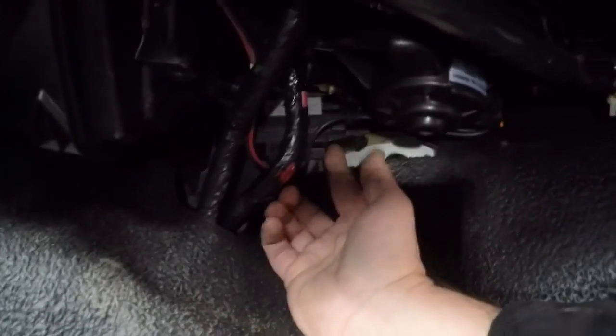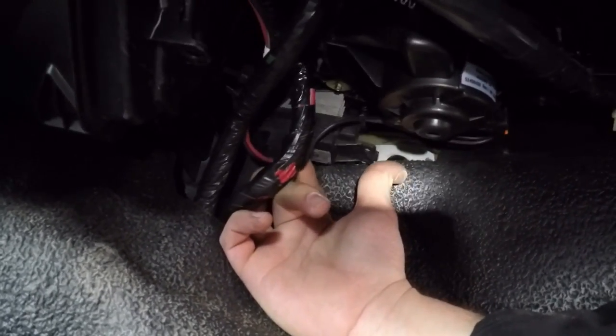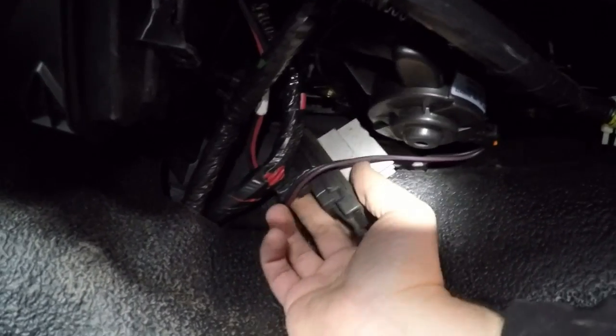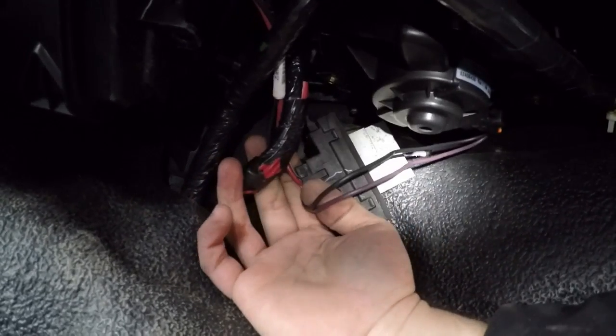The BCM is under here. You can see it's hanging down because I've already got it loose. If you pull the wire harness free, you can get it out of there. To get it out, you're going to have to remove the harness from both the module. I unplugged the motor from the black and purple wire that continues from the control module. The tabs on both harnesses need to be released so you can get the plug out — just use a screwdriver to make it let go.